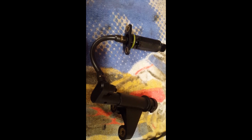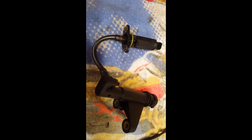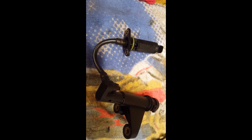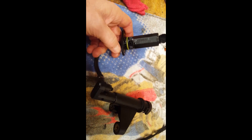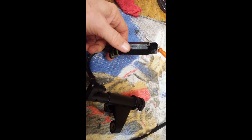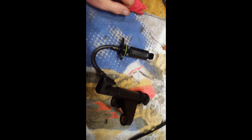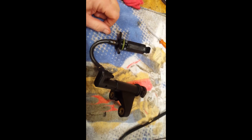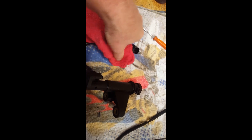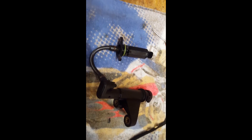That's just my theory — I can't prove it — but if you've got an oil leak on your Mercedes E320 or E430 and you don't know where it's coming from, and you've had any kind of maintenance done on your car, you might have bumped this sensor just enough to crack it. At least in my case, that's where my oil leak was. It's now fixed, and I'm pretty happy about that — so I just wanted to make a short video to let you guys know.